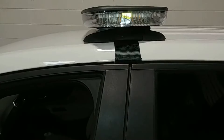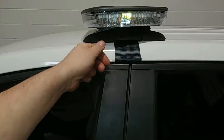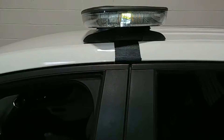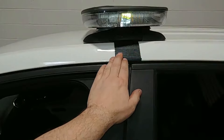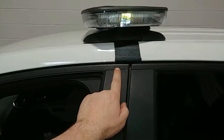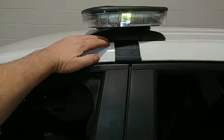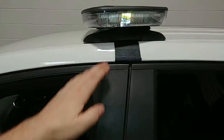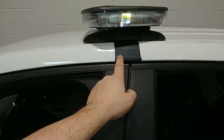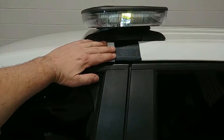To be a little more specific about what I mean with strap mount: behind here you have a bolt and a knurled coil that hold this strap. You basically pull it nice and tight and then bolt the two bolts tighter, which actually puts tension on the strap. This fat heavy-duty seat belt strap — about four times what any car seat belt is — actually gets affixed with fasteners up under the drip rail right here. What I like about this is it allows any curvature to this rail to work. So if there isn't a ready-made pre-bent light bar bracket, you can use the strap and it will conform to the structure.